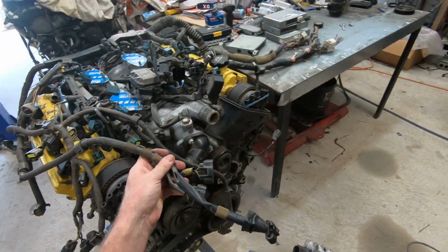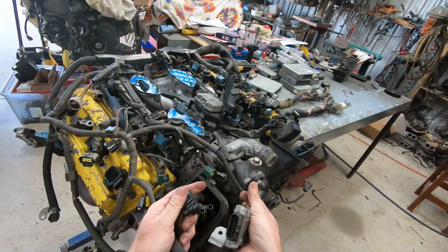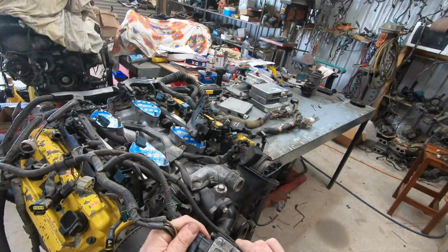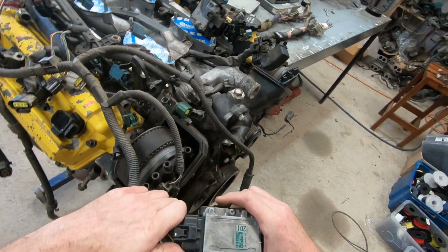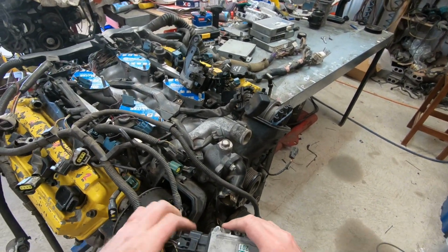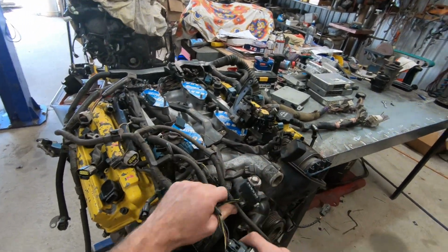UCF10. Oh, yeah. Nah, just breaks the plug. Won't fit. 201. Let's grab this UCF20. Oh, look, if I push it hard enough, it almost goes on. The plug is actually a different shape. So if you're really animal, you can push it on, but you're going to get some major running issues if you fit the wrong igniter on a UCF20 1UZ. Simple.